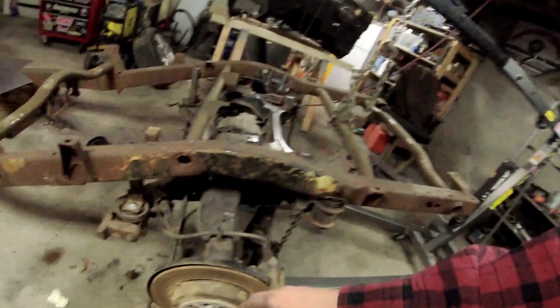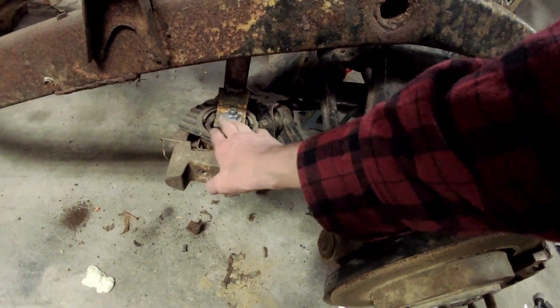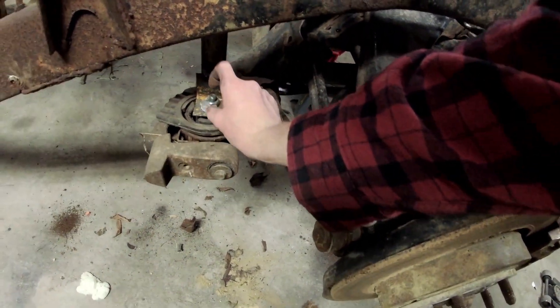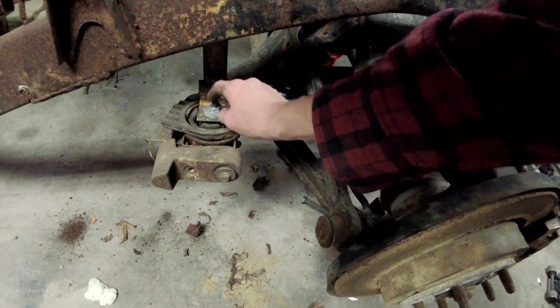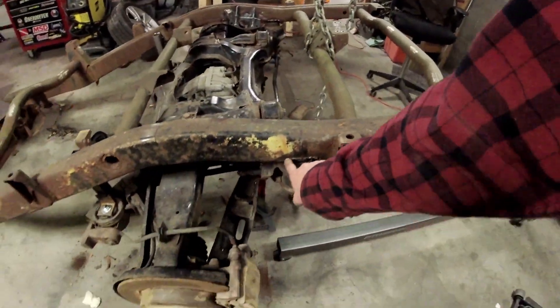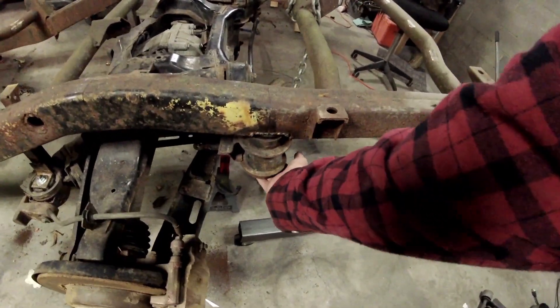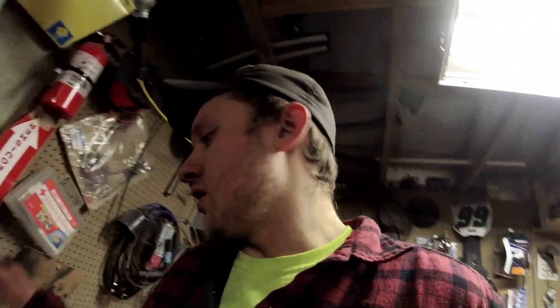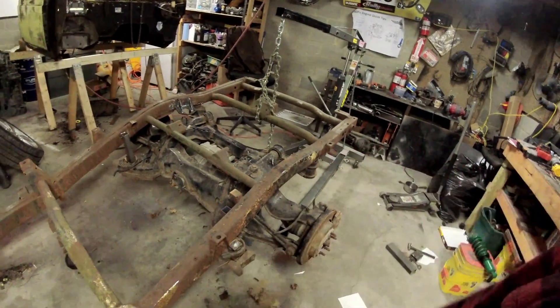For the final fabrication of this front mount, I'm going to measure and do some actual nice work here — put a sleeve with a washer in it so this can bolt to that sleeve and have some supports to go to the frame, to make it aesthetically pleasing. Calvin brought down the actual G8 subframe bolts — they're huge, big coarse thread. We're going to get the nuts that fit these, weld those nuts inside the repo frame, then use the stock bolts to hold it up. That was just some temporary stuff, but I'll cut those out.